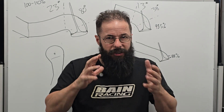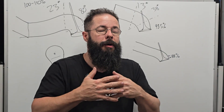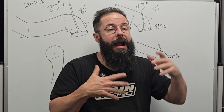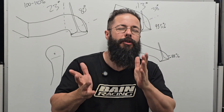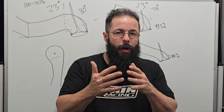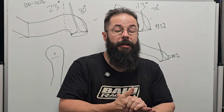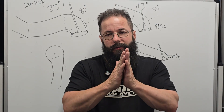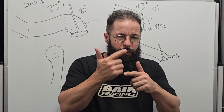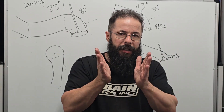Depending on OEM port design, you might find they shrink to the window and then expand in the intake, or have a really long parallel intake. This isn't optimal for racing. We can't look at an OEM head and say 'that's right' — it may be right for emissions or a wide power band. We need to really understand what we're dealing with and what we're building it for.